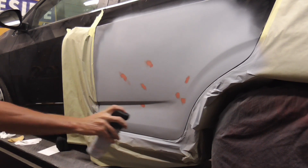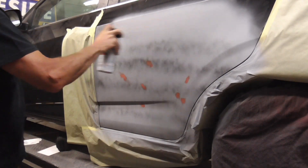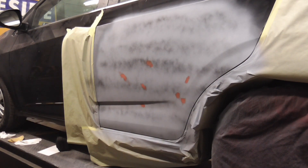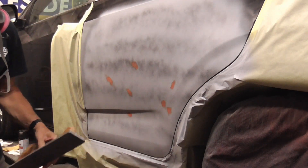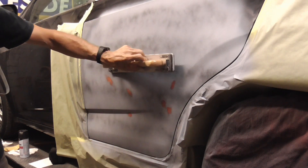Here's an up close shot — you can see that if you start sanding and there's a low area, there's going to be some black paint or at least a few dots in those low spots, and you can easily pick that up. We'll be block sanding with a nice straight 10-inch board and 120 grit. To get it even straighter you could use a longboard, but it might be a little too big for the area.